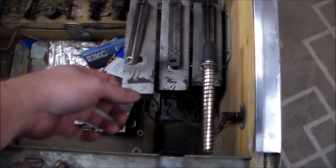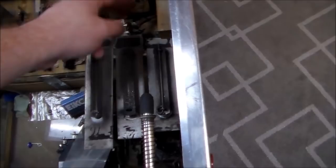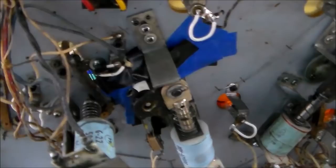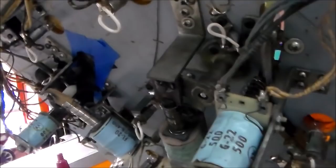All the coils look pretty good. Here are the chimes — they're going to need some work. I think somebody may have been messing with those that didn't know what they were doing. There's a flipper rebuild kit here from the Pinball Resource, which is a good idea. But when you rebuild the flippers, taping them onto the play field — that's a bad idea. All of that's going to need to be figured out. You're not going to get good flipper action out of that.